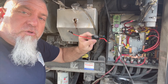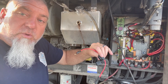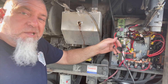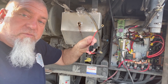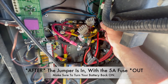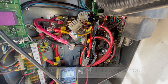As soon as you put this in and put a fuse in there, the ECM is going to be powered. So if you're just sitting here like we are, pull the fuse out so the ECM is not powered. I'm going to put this in here just in case we have to leave — we'll have a way to leave. After you put your jumper on, make sure that you tape up both ends with electrical tape.